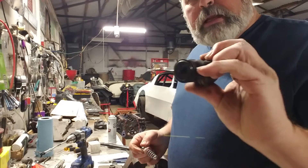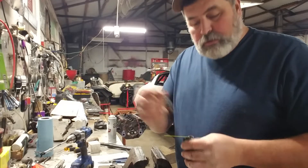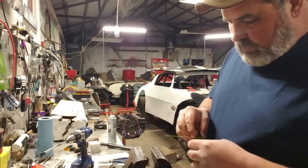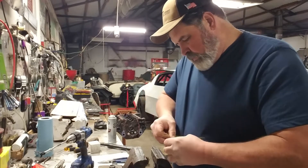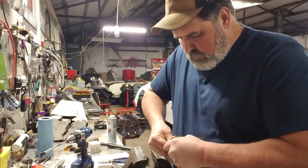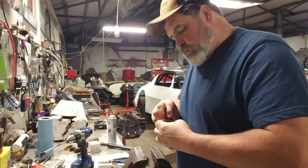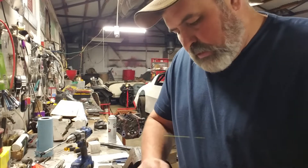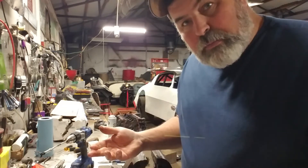Okay guys, got that end in. As you can see the rubber is in it. The plunger is on that side. Put the center spring in — make sure your cup is pointed inward. Put that in and make sure you don't damage the lip. Just pop that in there, take your piston and put it in. The rest of it is repeat. Those seals are not easy to get in. Sometimes when you drop it you'll knock it all apart and you've got to start all over.